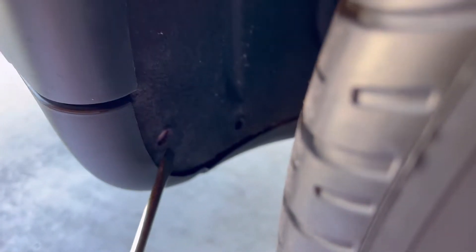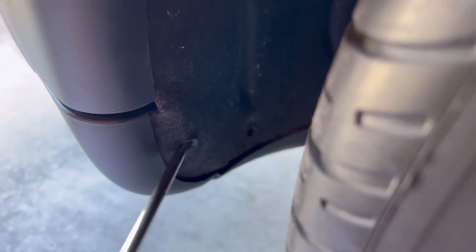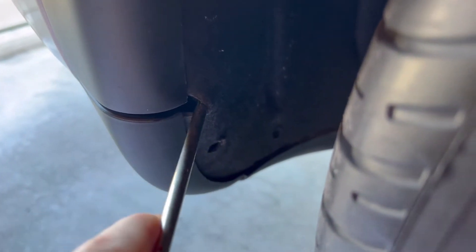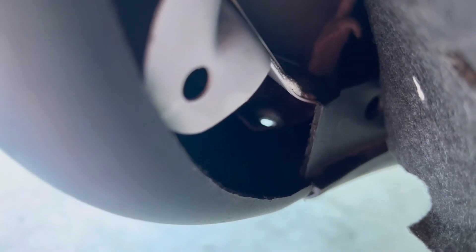These two body bolts or pins are out. We can just take a screwdriver and kind of work that lining away just a little bit — just enough to get a finger in there. You can pull this out; don't be too shy about it. With that pulled back, we now have easy access to where that bolt was coming up.